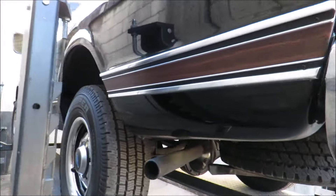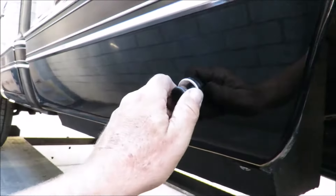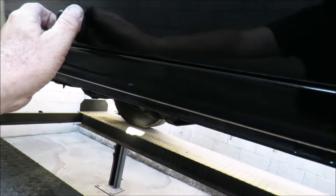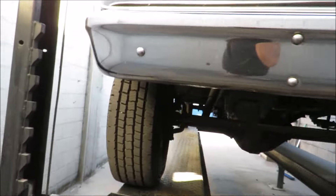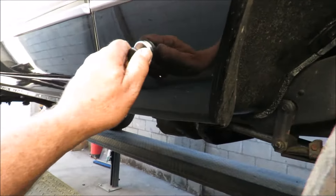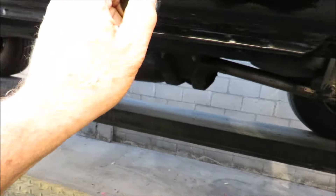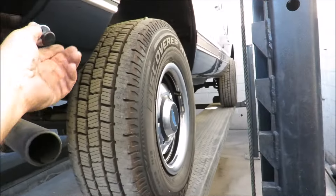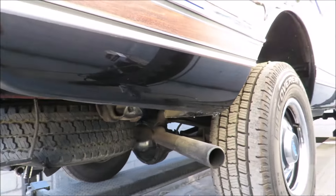We'll run a magnet around this and just show you how nice this truck is. This is a big concern with trucks — especially ones coming out of the Midwest and the East — is that they've had a lot of bondo and filler. This California truck is super, super solid. The paint was done several years ago, so obviously if there was any rust, it would have come back by now. It's my understanding it just doesn't have any.